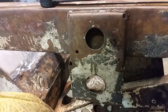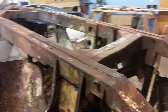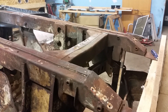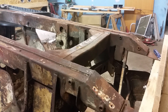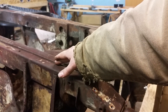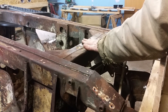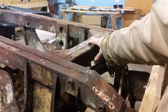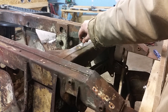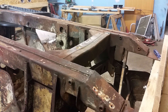Funny how dirt accumulates after so many years. This is the front end of the car under the engine - it's upside down. What typically happens to the frames on these is people jack them up, and because of this ridge right here that takes all the load from the jack, it ends up crushing it down. That's exactly what happened on this crossmember. I'm going to drill a hole and screw into it to pull it up - like a slide hammer, but I'll get creative.